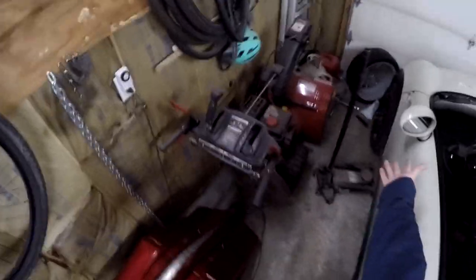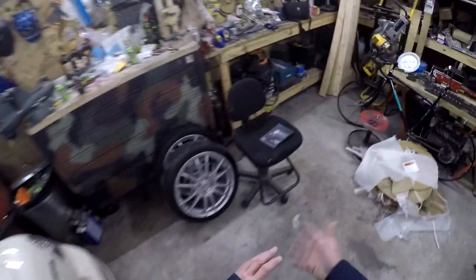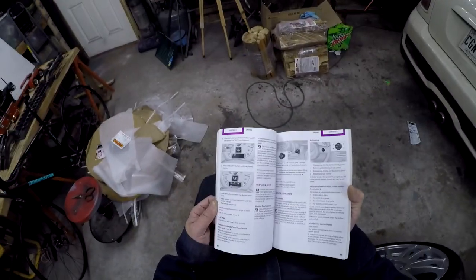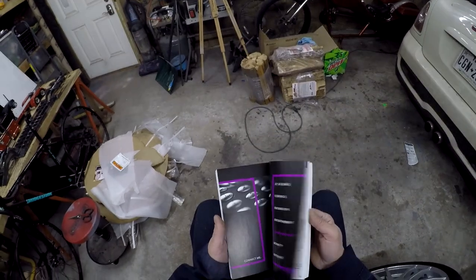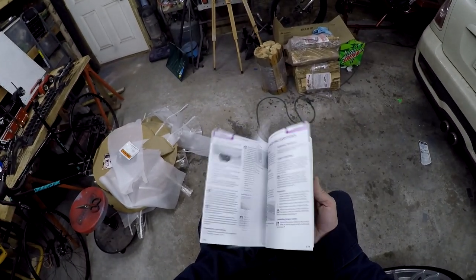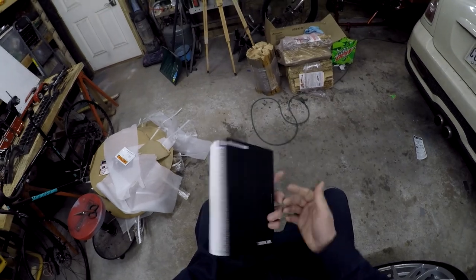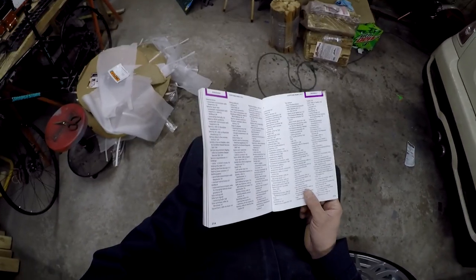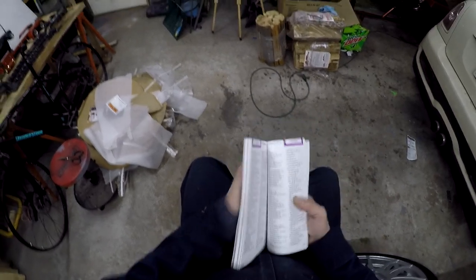All right, I've got all those things roughly where I'm going to be using them. For the first one, I'm going to do the front side first. You want to make sure you set your e-brake. If it's an automatic or anything that's not four-wheel drive, once you pull the drive wheels off it can move — I don't want it to move. Now here's where you want to consult your manual. I'm looking for torque — tightening lug bolts — there we go. Torque: 175.